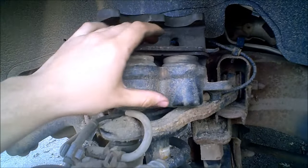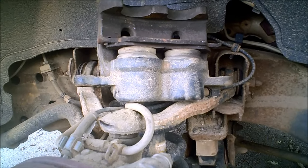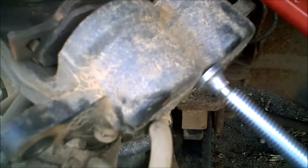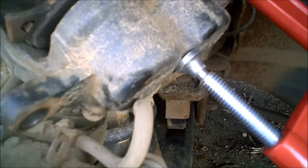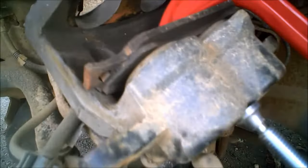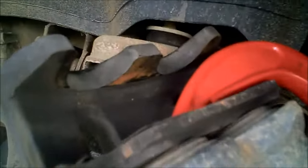Clamp it down one side at a time and then we'll be good — pistons back inside. I've got my big 6-inch C-clamp right there and I'm tightening it up. Those pistons are going back in place. I'll just get them about flush and then put it all back together.